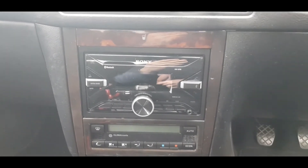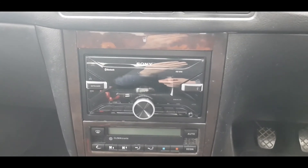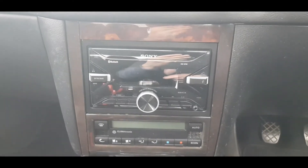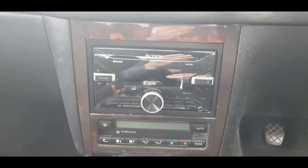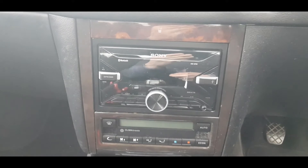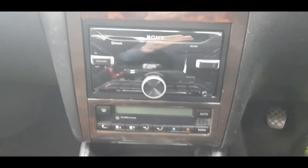Going back to the red wire and the yellow wire — in my particular setup they actually pull out really easily, which is super easy. But in some other setups you might not be able to just pull them out; you might have to seek some expert advice. Mine was pretty straightforward. I've switched over the red wire and yellow wire and put the head unit back in.